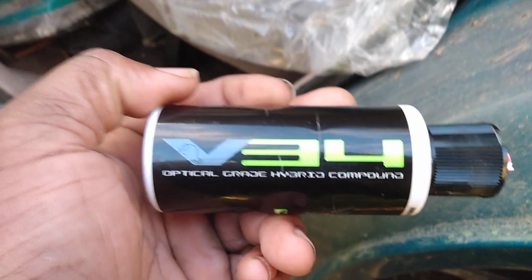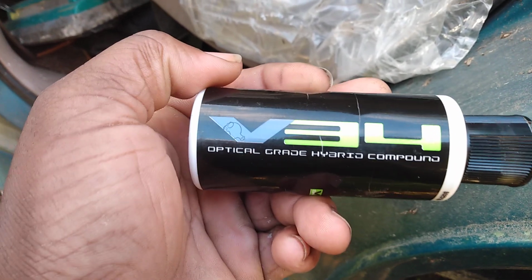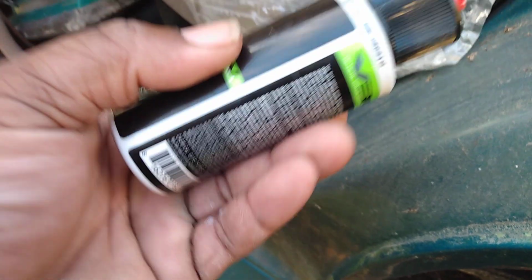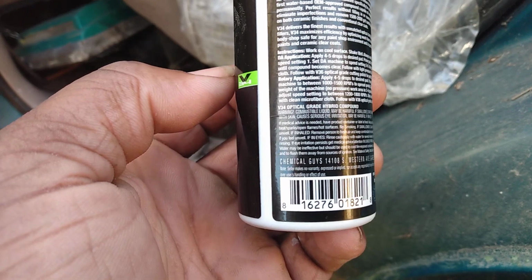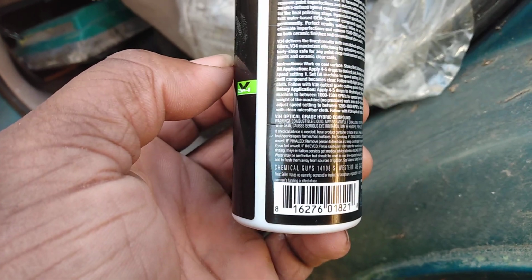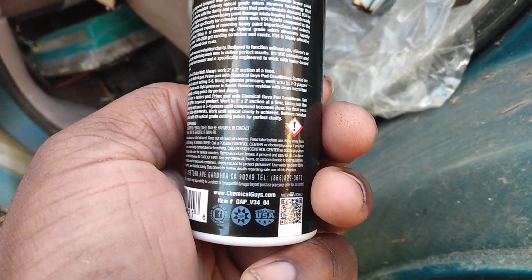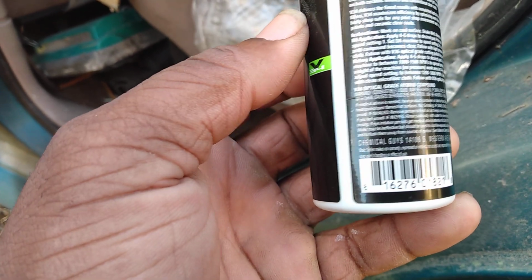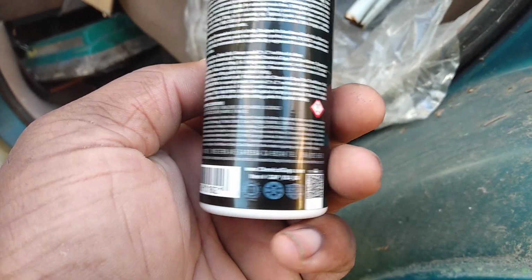The V34 comes in a kit that I have, which contains V32, V34, V36, and V38. The wind is up here some, guys. A little fine print right here, and it is saying: work on a cool surface, shake well, always work a 2x2 section at a time. For DA application, apply 4 to 5 drops to the desired pad, prime the pad with Chemical Guys pad conditioner, spread on evenly, and set the DA machine to 5 to 6 using moderate pressure.